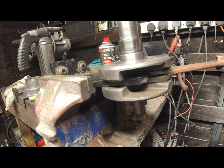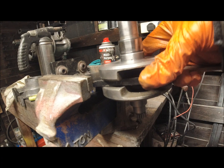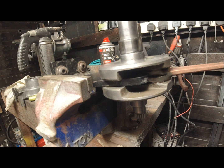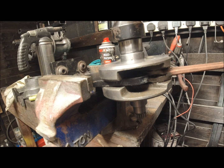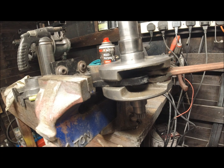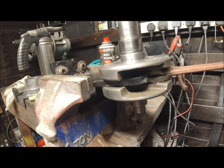If you've got one of the crank balancing tools, you can just literally take the bearings off and put your crank in there. It supports where the pin goes down, and basically, if I can just block that, put your race on for your bearing. There you go. 5-minute job, supporting it. You're not damaging your crankshaft. So literally took me a couple of minutes to do it.